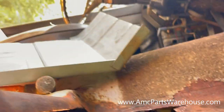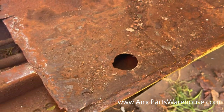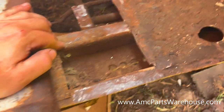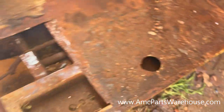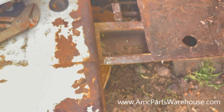When it's filled I have to spray everything — it's a weld primer. There is absolutely no rust in this rail, it's not rust. Just in case, inside the rails I can use POR-15. But this car will never see weather like it was intended back in 69, so I'm not worried about it — it will see no rain once it's finished.